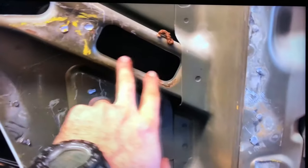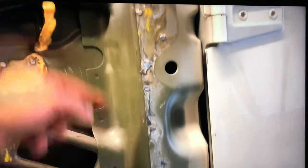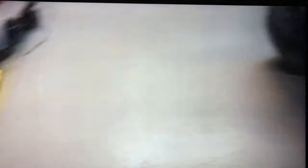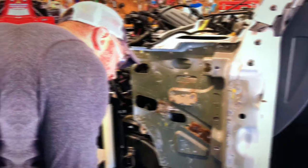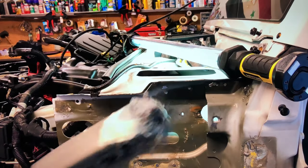47 spot welds — that's off. Here's the apron. Two spot welds in that hole, four in this one. I'm not sure about there because I've got to dig this stuff out — probably two in there, and there's one in this one. There's one on the outside and one on the opposite on the back side. And there's going to be a bolt, so I want to take off the inside of the Jeep. There are two nuts that are welded on. I'm assuming there are bolts on the back side that pull it in from the inside. There's enough room in here — it slides out. That is amazing.